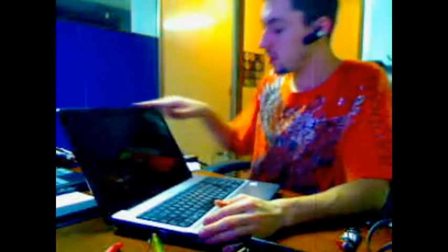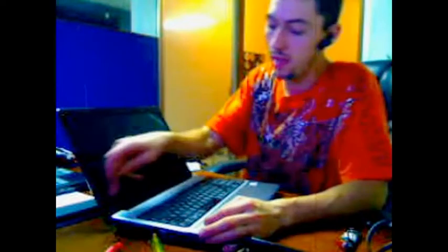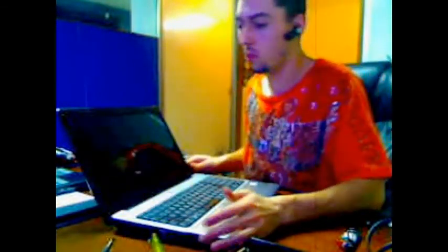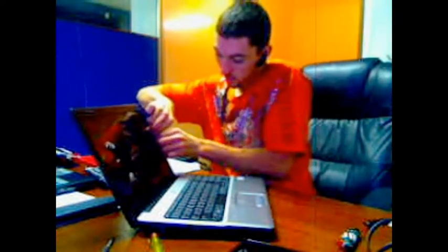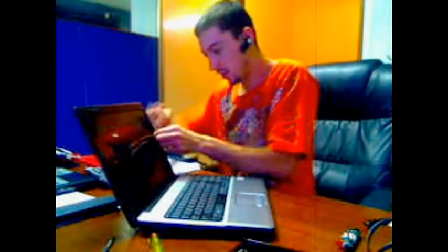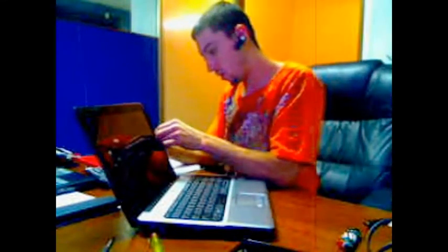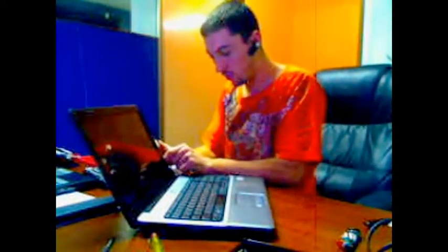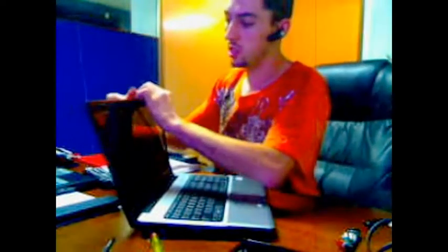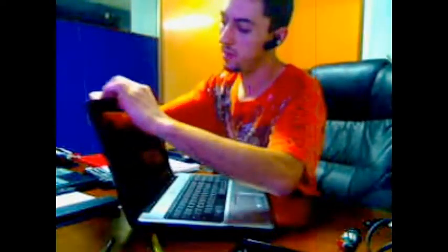What we're going to do is flip this over, open up the screen, and basically this whole piece is going to have to be pried off. There are two screws, one here and one here, and you're going to need to use a small Phillips to get in there because it's kind of behind the corner. We're going to start prying this off, gently get our fingers in there, and then just work it until it starts lifting. You want to be gentle — you don't have to pull too hard, but just enough.